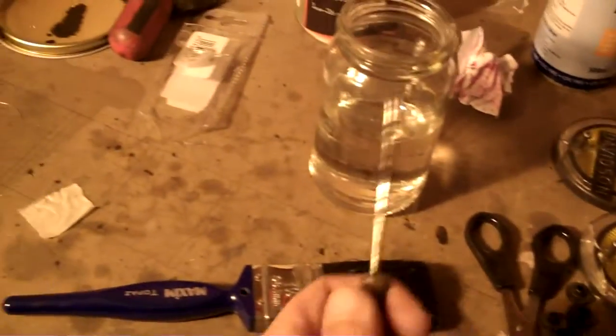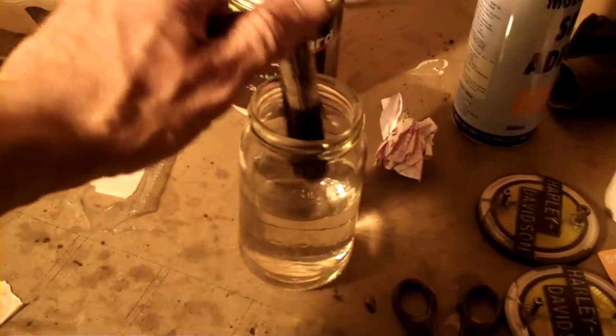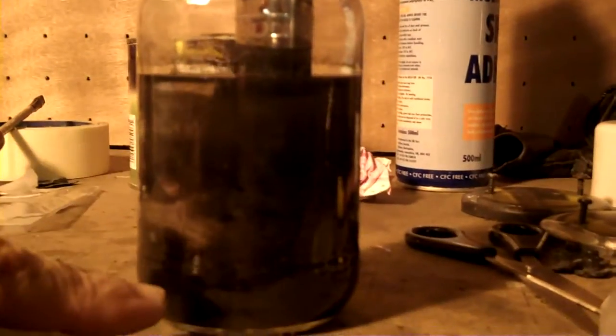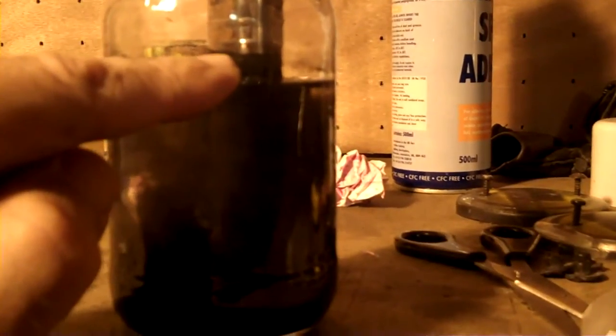So get yourself a little bradawl through the hole like that, then put the brush in the terps, and the brush sits in the thinners but off the bottom, so all the solids sink to the bottom and they're harmless to the brush because it's above. And make sure you've covered the bristles. It's not quite on this one. I can undo a safety cap with one hand.